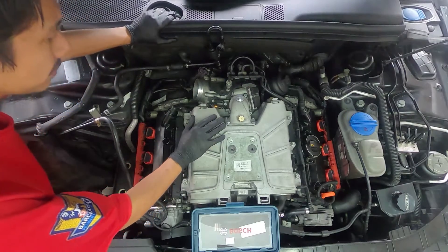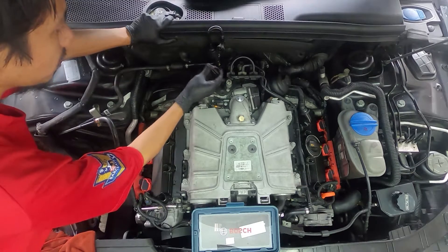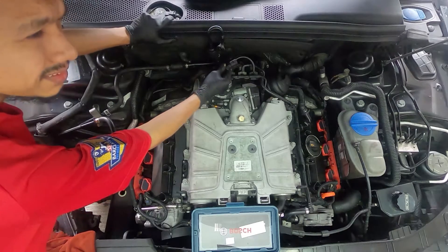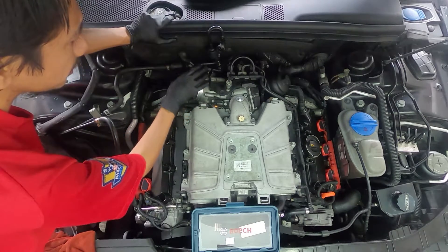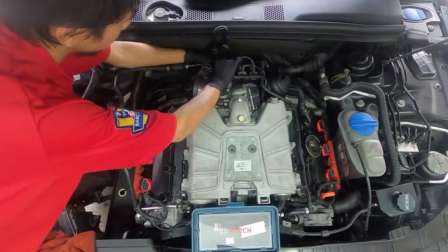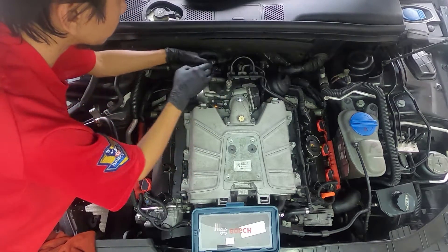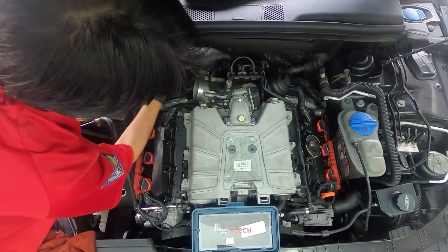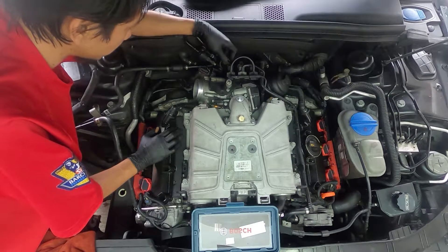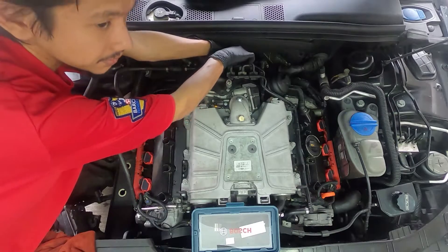You don't really have to force things. These clips are waterproof and really tight, but just push the clip properly. And never pull from the wires — you want to make sure you pull everything from the clip. Some people like to label the connectors and it's better if you do, but I don't — it's not my first time.